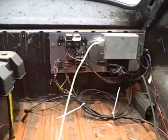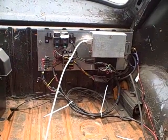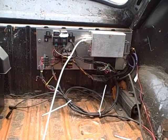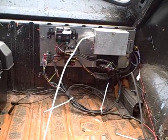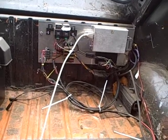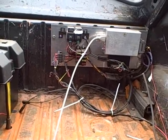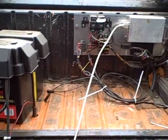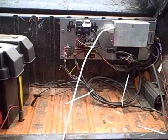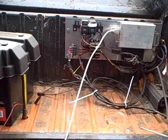The Mega Squirt unit itself — there's the Mega Squirt 2 unit, the silver box. Right underneath it is the Ford EDIS ignition module. This is all mounted on what is sort of a firewall for the Beetle. The other stuff on that silver plate on the left is a couple of relays and fuse blocks for the Mega Squirt unit, and a little terminal strip I used to bring the wideband O2 in, since I don't really intend to run the wideband O2 forever.